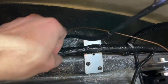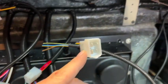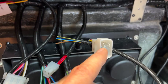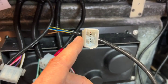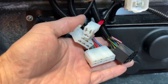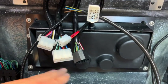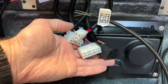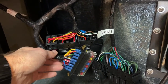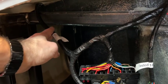There are a couple of supports I can use to zip-tie everything. Here we have the heater wires — I need to work out which one goes where. We don't use all those connections because there's no speed setting, it's just on or off. These four connectors — 11, 8, 6, and 3 — all go into the dashboard connectors, so they need to be fairly central within the area of the center console so they can easily be plugged into the dash. Then we've got a fuse block and all the relays.